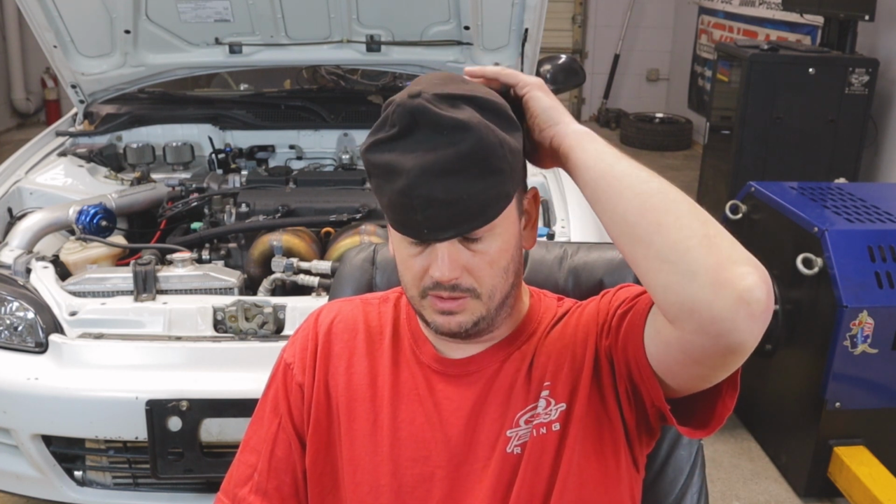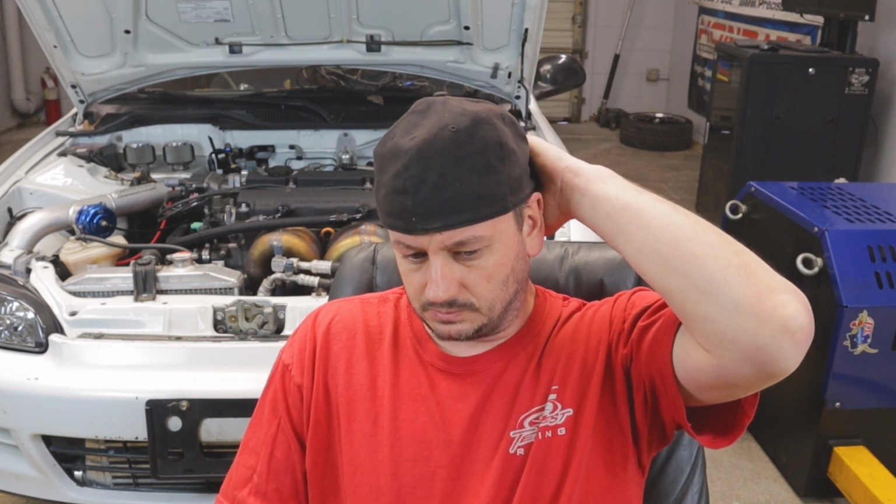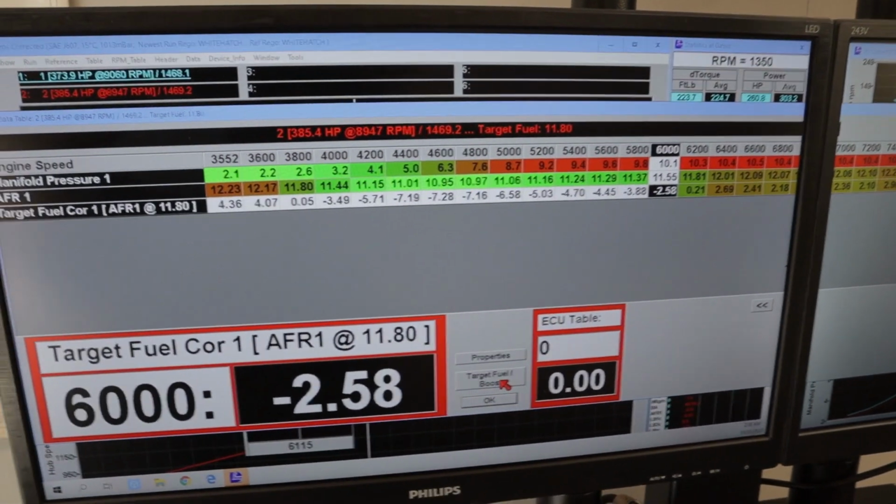So mine is technically rated at 3,000 horsepower, but ultimately it can hold, I believe, 9,000 foot-pounds of axle torque. So that's going to take 9,000 divided by the gear ratio of the car. That's how much engine torque it can hold. And unlike other dynos where you exceed a certain value and the dyno just shuts down and freaks out, on this one it'll essentially act as if the clutch is just slipping a little bit in the car.